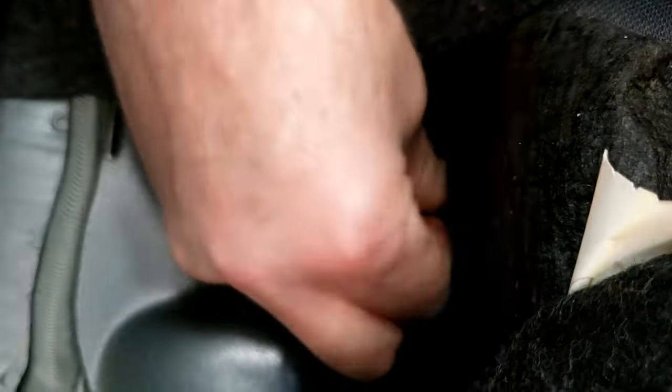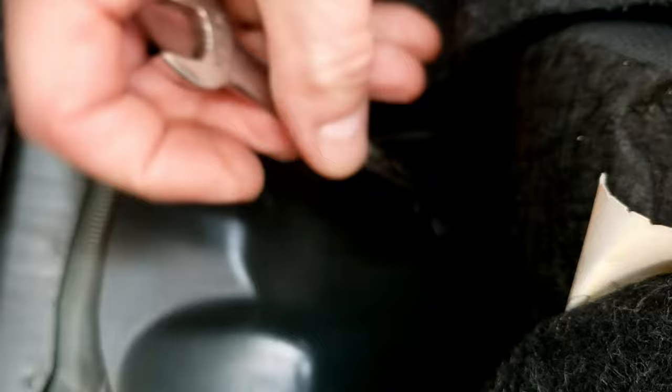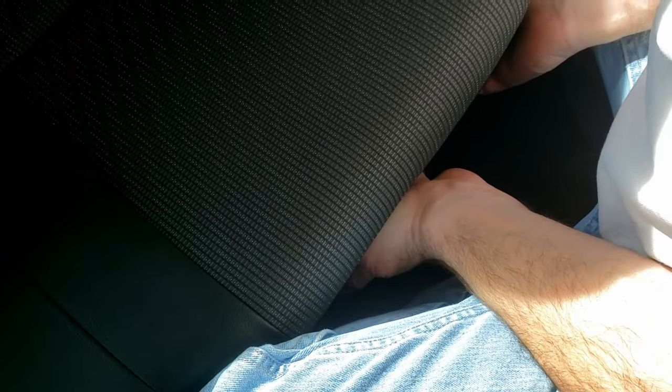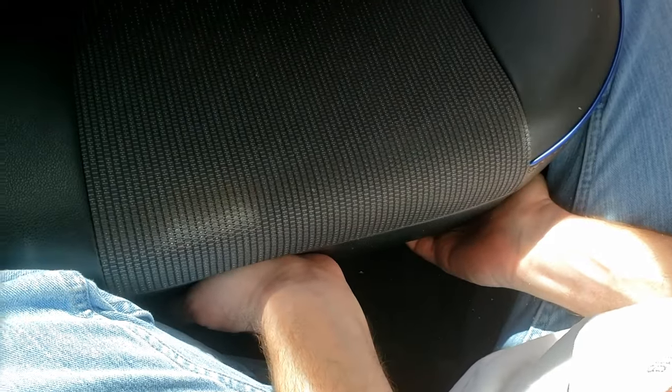I don't have any choice. The next step is you got to go ahead and push your backrests back in place, and then come down to the front of the seat — around probably eight to ten inches from the corner. Put your hands down underneath the cushion, and you'll feel when you pull up on it where there's kind of a point that's tight. If you go way over to the right you can feel it kind of pivot, go to the left you can feel it pivot — this is the focus point. Put your hands underneath on both sides and pull up straight with your legs squatted.